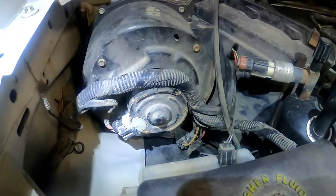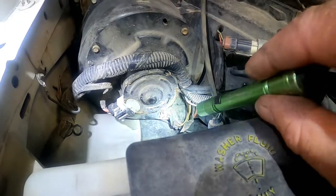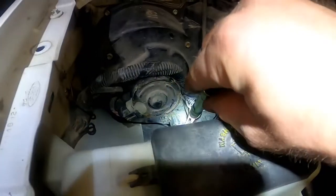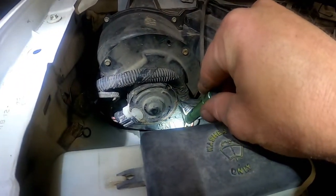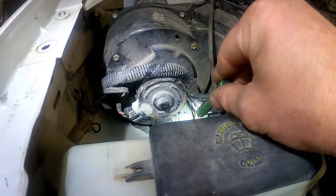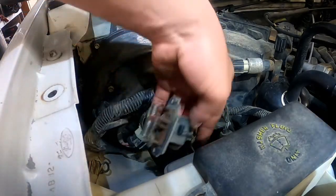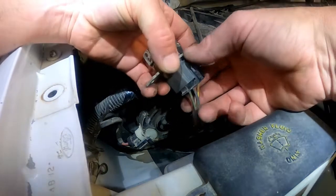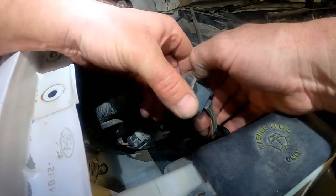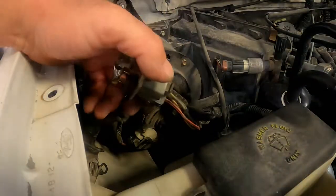Now you've got a better view. Right down here is the blower motor resistor — and you can see it's definitely not anything new. Looks like we're gonna have two 8 millimeter bolts to get it out, and I'm gonna have to unhook that connector. I'm gonna get that done because you won't be able to see anything with my hands stuffed down in there. So I unbolted it — now I can pull it out. You see how crusty it is? I left it plugged in because this clip is on the bottom and you can't really get your hand down there to unplug it — and boy, that sucker is stuck in there too.